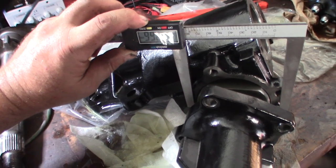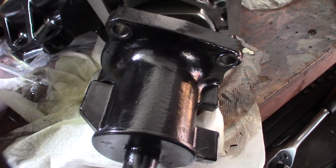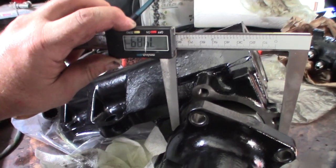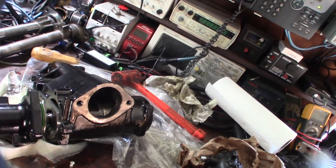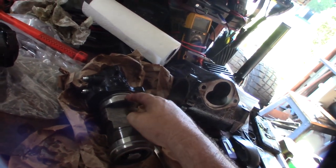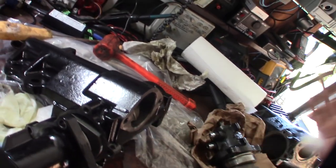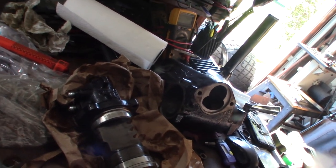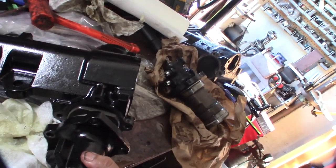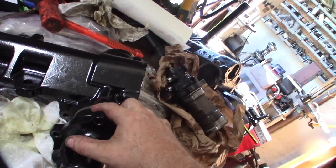So about 79.89. This would obviously have to be. So yeah, I don't think this can be used as a 442 box donor, because this piston right here is a millimeter bigger than this piston. This is like 79.80, and this thing is like 80.80. So it's about a millimeter bigger. In theory, this thing won't even fit into this bore. There shouldn't be enough play in this bore. That's a tight clearance fit. There's no way I'm getting that thing in there.